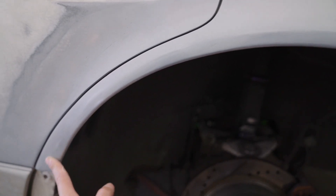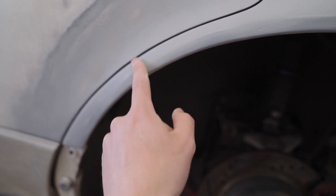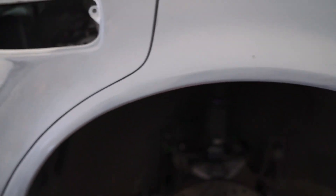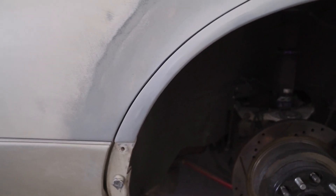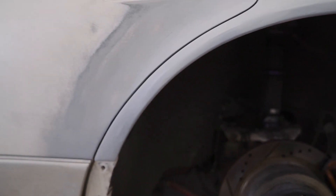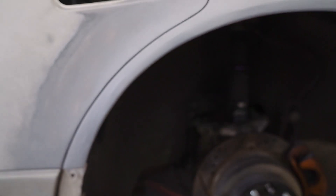I don't know exactly what I'm going to do with this. Whether it's worth taking the grinder to these little spots lightly and just kind of smoothing them out, then using bondo to basically get this as one kind of smooth piece that gradients into this line - I feel like that's my best option. I'm not going to be able to recreate this line out of bondo, it's just not worth my time. So I think the best option is to shave these two spots right here down and get this as smooth as I can, being careful not to affect the areas I've already gotten right.